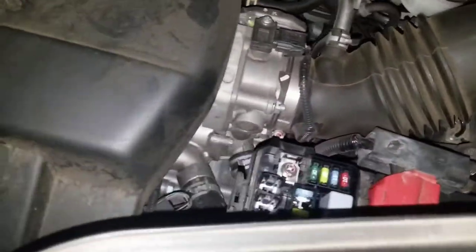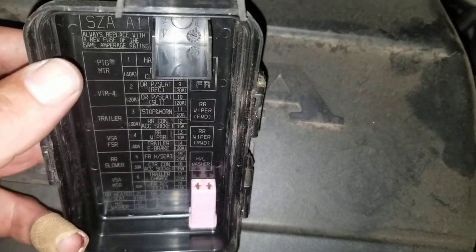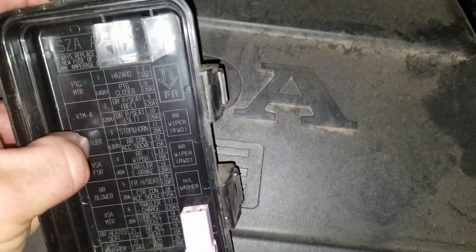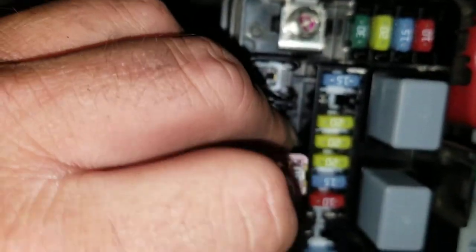The last thing - come around to the front of the vehicle. Right here in this fuse box, when you pull it off, you'll notice it says 'trailer.' The kit comes with this fuse and all the needed hardware. Count one, two, three where it says 'trailer' on these right here - I've got one, two, three. Take the fuse, count one, two, three, and put that fuse in that hole. Then put your fuse box cover back on.